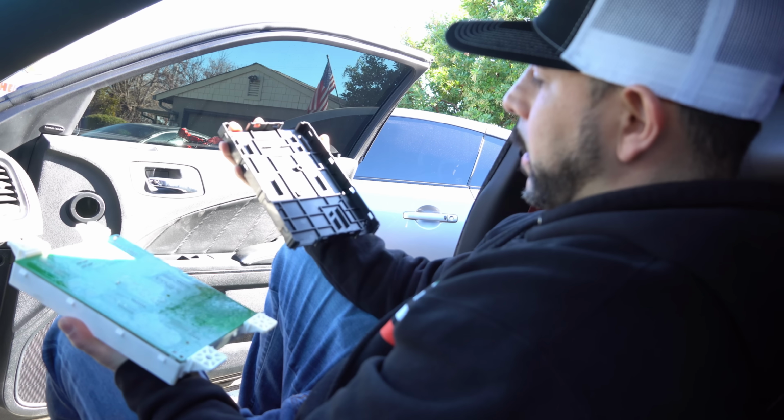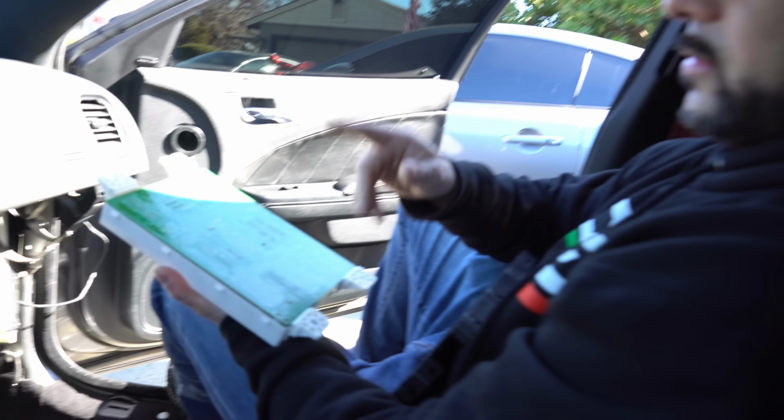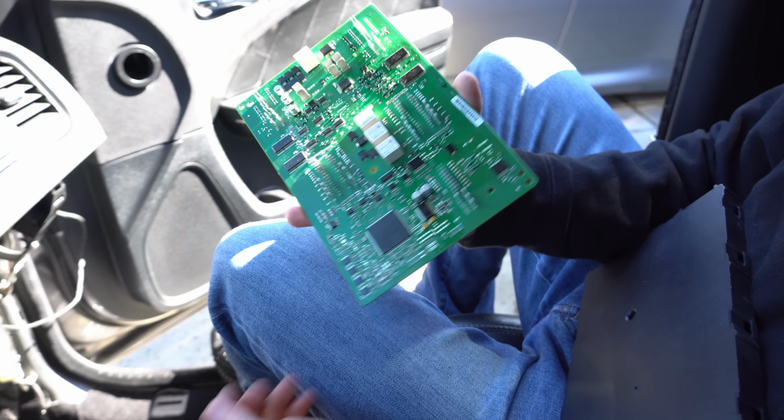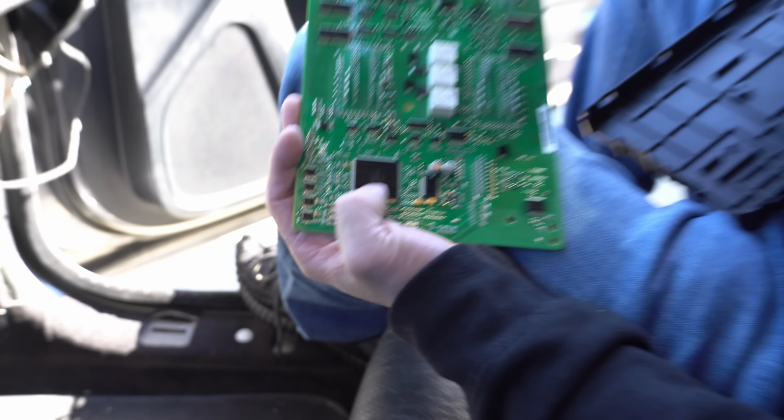So I went ahead and I opened it, right? Because the issue with this is the backside of it. The issue with this truck, after it was stolen, it wouldn't start. Okay, so I did all my diagnostics. I didn't have run start relay. So what happens with these cars inside, right? This is everything that's inside your BCM. Everybody's looking at like, what the hell is that? Yeah, that is crazy looking. This is your EEPROM. Everything changes from a Trackhawk to a regular SRT to a Charger to a Challenger, and this is the main data right here out of this one, right?